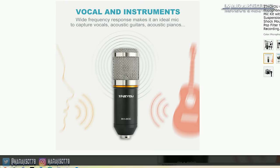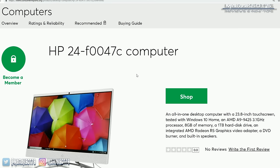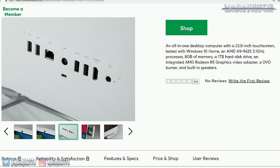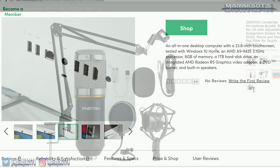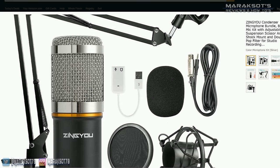Trying to use a four pin headset in a three pin jack is the most common problem I've seen in the comments on my other video. However, there is one person I came across recently whose mic wasn't working but they needed a slightly different solution to their problem. This particular individual was using an XLR studio style microphone that connected to an audio interface device, which then had an XLR to 3.5 millimeter adapter cable that they were plugging into their PC. Their PC is a newer model all-in-one HP which has a single four pin TRRS 3.5 millimeter jack on the back. The XLR to 3.5 millimeter adapter cable that came with their audio interface device converted to a three pin TRS connection. Since their PC had a four pin jack, the three pin adapter wasn't being recognized and they were unable to use their microphone.